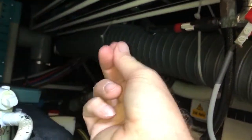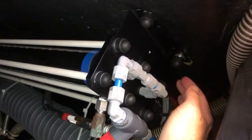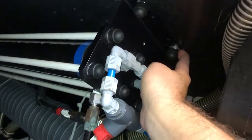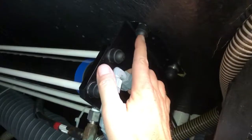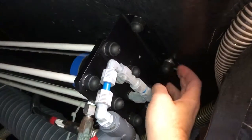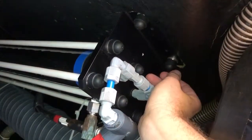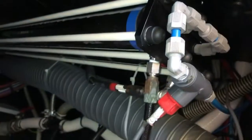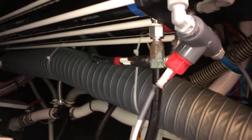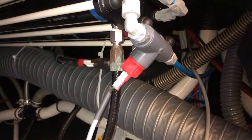It's also important that you don't screw one bolt all the way in first, because then the other side will hang off at an angle and you won't be able to get the hole on the bracket lined up with the bolt. Only screw the nut in a couple of turns on the first bolt and let it hang, then push it up onto the second bolt and start those nuts too. Then you can push it up together and it goes in easily.